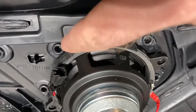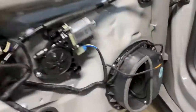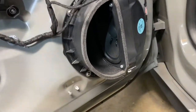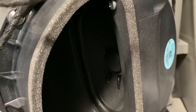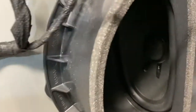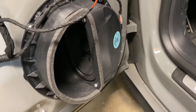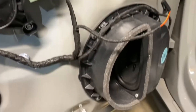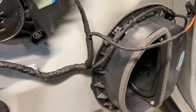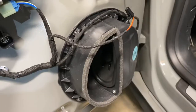These come with four tabs and you can just see where the old one was, but everything fits perfectly — couldn't be more of a direct replacement. Moving on to the woofer. As you can see, this is just our other speaker that's in the door panel. This is how the stock woofer is mounted — kind of that little peekaboo. I'll actually measure that and see what size it is, but it's like a two and a half by five or two by four — a weird size speaker. There's a pretty significant difference, as you heard in the video switching back and forth between the woofer on this side and the woofer on the other side. Also the clarity from the mids is just pretty noticeable. The new setup is much better.